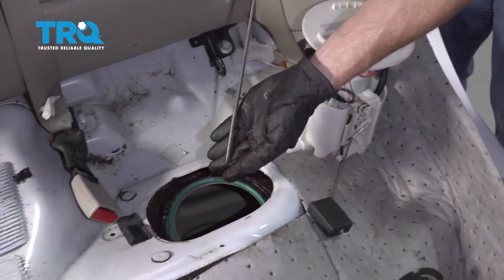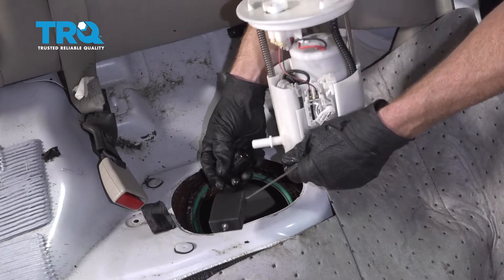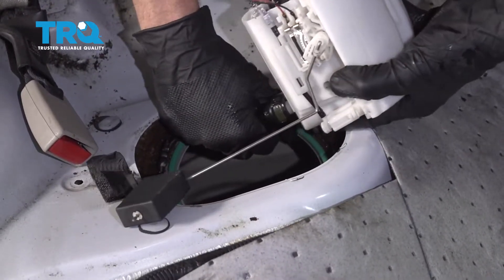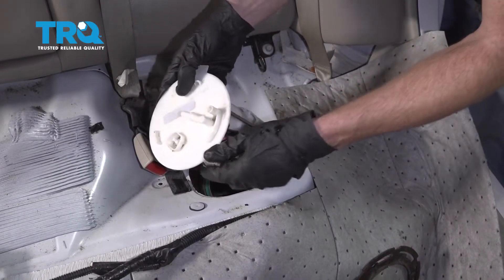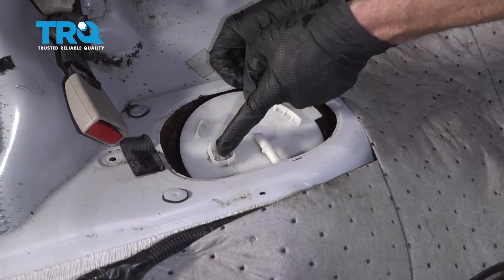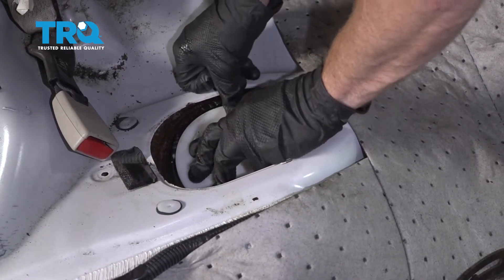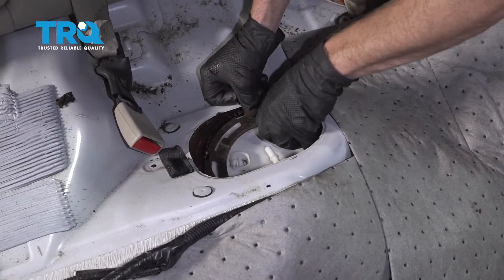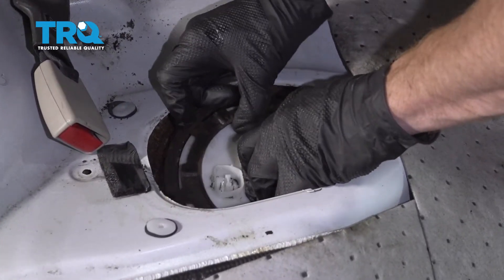The next thing is to get down inside this fuel tank and grab that fuel line — I don't like to reach inside the gas tank without gloves. Take your fuel pump and connect the siphoning line in — press it in, listen for a click, and make sure it's secure. Once connected, carefully put your fuel pump level float inside the fuel tank, and then start putting the fuel pump into the fuel tank as well. Carefully slide this down and line it up — remember that you had your wiring coming right across this area, so it's easy enough to realign that. Bring this tab right down in between the two ears and press it in.